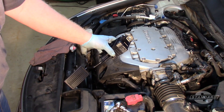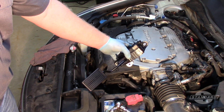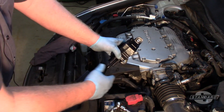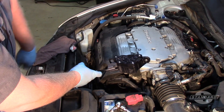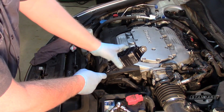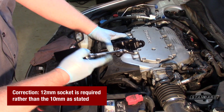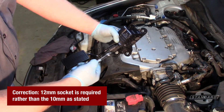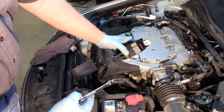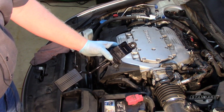So why am I under the hood? This assembly is located inside the driver's compartment but it's a little difficult to see, so before I jump underneath the dash I want to quickly show you where there are two mounting points and the electrical connector on the top. I'm going to take my ratchet with a 10 millimeter swivel socket to remove the mounting hardware, unbolt it, reinstall the new one, do a couple relearns with a scan tool, and it'll be done. Let's head underneath the dash.